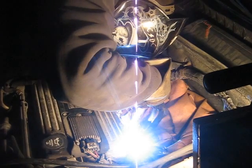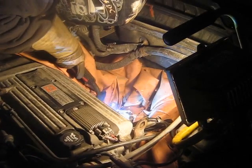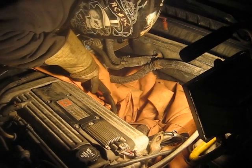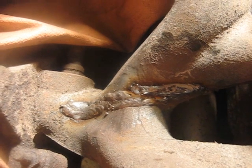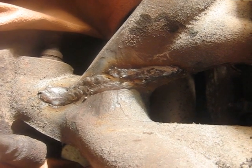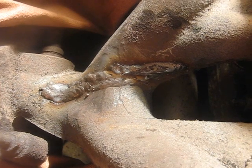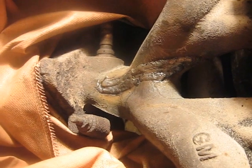I'm going to see how the camera likes the arc welder. I would say if we start the car up, we won't have any problems. I'll show you what he's done here. He's going to weld it up there — he's using a 70 type hard wire on it. So you can see the crack all welded up there. He's just MIG welded it with a regular 70 grade wire and CO2, and it looks like it's doing really well. I'm getting some heat here because we had the engine running to heat the manifold up. We've got the engine running, keeping the weld warm.